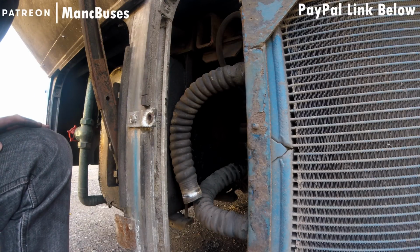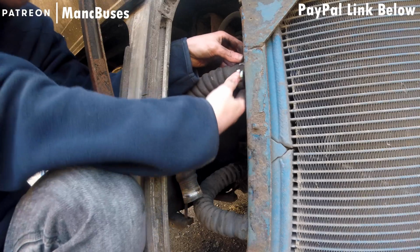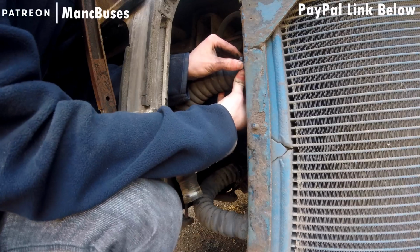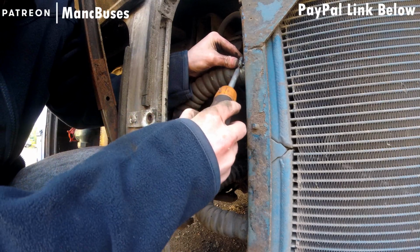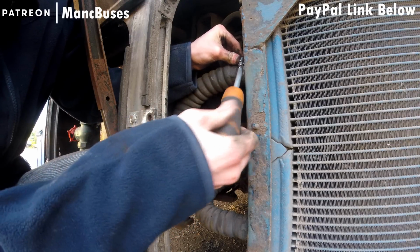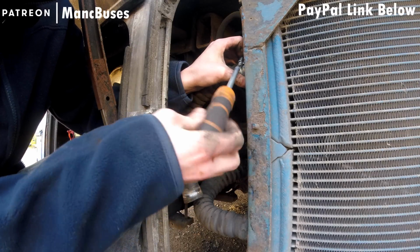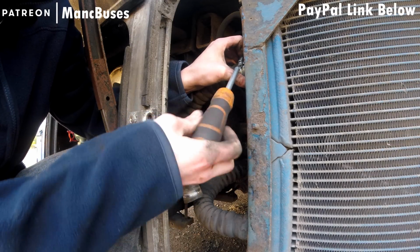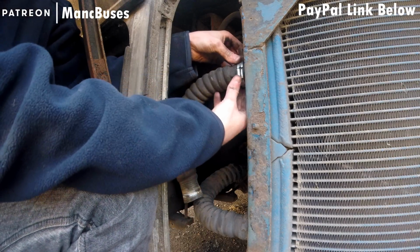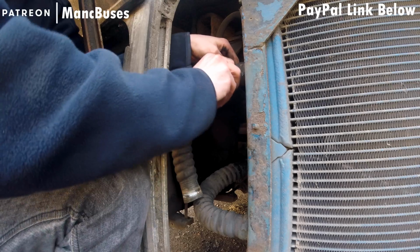Those are what I can't remember. I do believe, from my memory, that the top pipe was a thicker fitting, which I ended up using, if I remember rightly, a 32 to 50mm hose clamp to ensure I've got a lot of extra spare on the hose clamp to make sure I can get it down really tightly. Better to use slightly too large and be able to shrink them down rather than use just the right size and only have a tad of the screw head on the hose clamp itself. That screw is what holds the clamp together. The pressure and expansion, you want that to be as firm as possible.